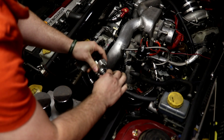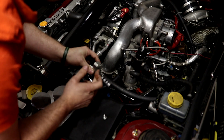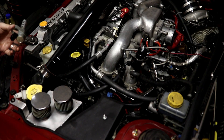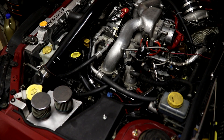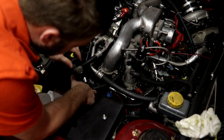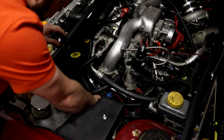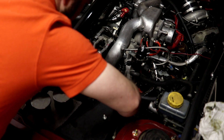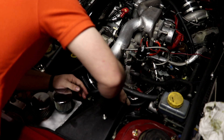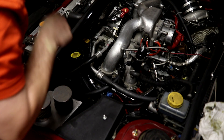Because it has this little O-ring seal, you want to take some oil and coat it. They seem to come pre-oiled from the manufacturer, but you want to do that regardless. You're going to notice some oil spilling out from the port this goes into, so just clean that up and then plug it in.